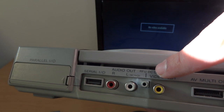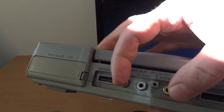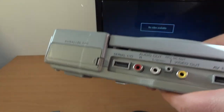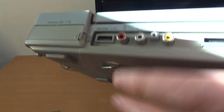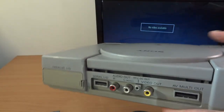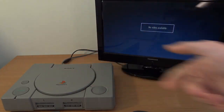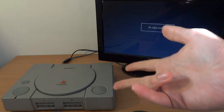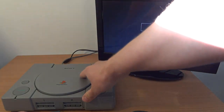But even if you didn't have something like that, the reason why on this very early model there is an RF DC out — I think it's 5 volts — is for a special adapter that connects here with a pin. It was only on this early model, and it would allow you to connect the PlayStation to a TV using the antenna cable, basically an analog signal like the Nintendo Entertainment System.